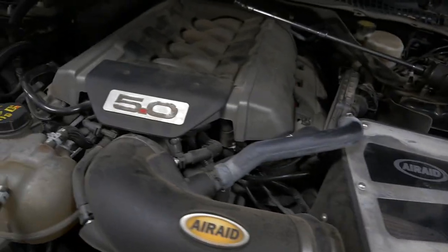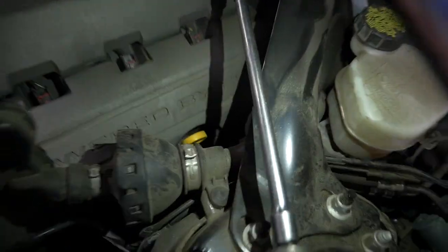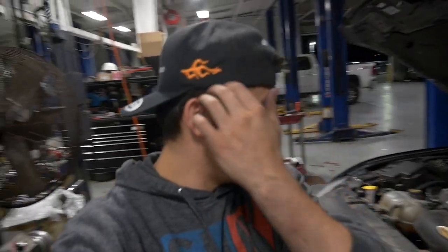For the longest time we were struggling with how to bolt down the engine mount — the loctite was on there really good. It felt tight but you could still move the washer around, so we were struggling. Now we're doing it from the top instead of the bottom and we were able to lock down some of these with power tools. One more bolt to go on the bracket, then plug back in the AC unit, connect the battery, do a couple other things we took off — and after that we should be done. I am tired and beat, and Chris has been doing the whole main thing.